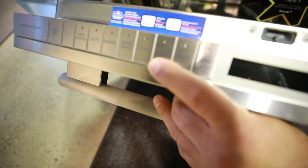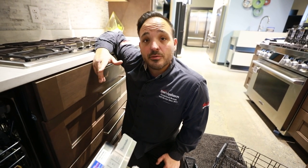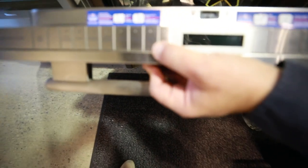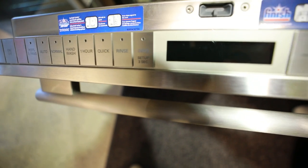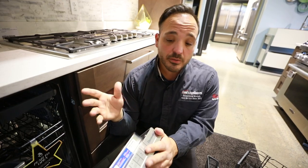Next: one-hour wash and quick wash. The one-hour setting runs high and hot for one hour — great for glasses or stuff that's already clean, whether you're bringing out holiday plates or items that have been in boxes for six to eight months. Rinse only is great if you just want a 15-minute rinse cycle to hold dishes for the next day without things getting funky — almost like a pre-treat.